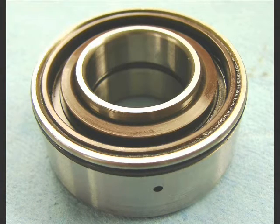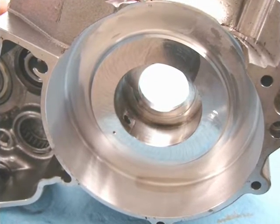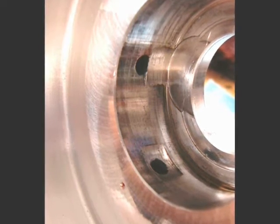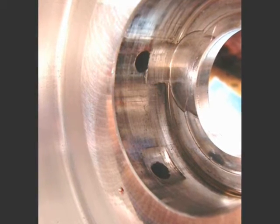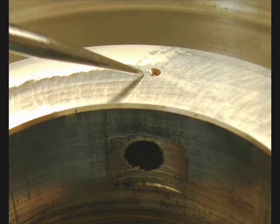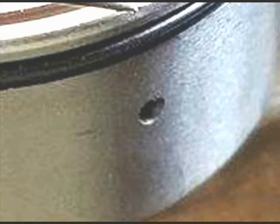Here we can see one of the crank bearings — there's a small hole in the side of the bearing race. In the left case half there is an oil feed galley. That hole in the bearing must align with the little dimple on the interior of the case half, which lets oil feed into that hole in the side wall of the bearing. It's critical that that dimple and that hole align with the hole in that bearing race. This only applies to the left-hand side bearing. The right bearing is lubricated by oil that comes into the back side of it behind the primary driven gear.